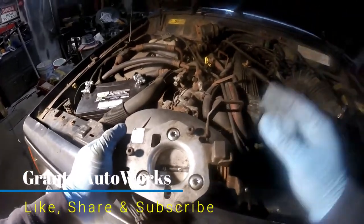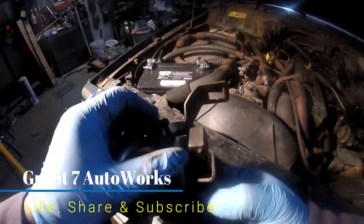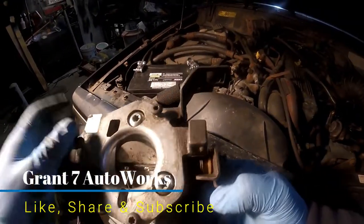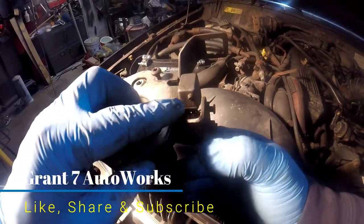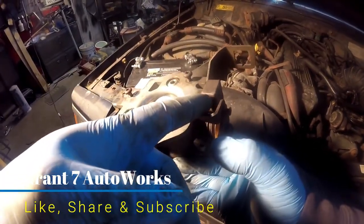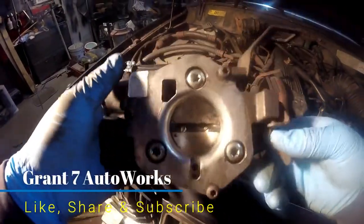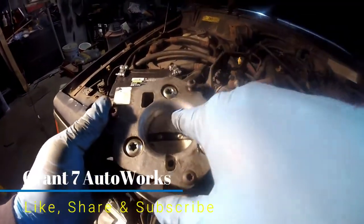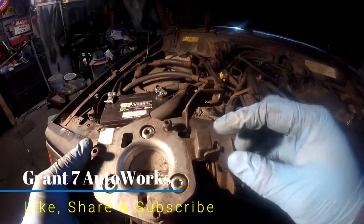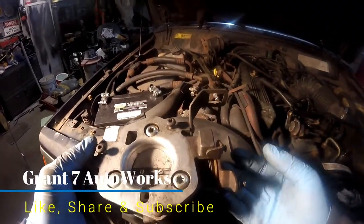So this is what I did to guarantee it works for me. I've not had problems since, so I figured I'll share it with you guys. You see this right here? This is your stop for your throttle. What you can do is use needle nose pliers or some grips and try to turn this in some. This controls how much air is getting by. Although the tolerance seems really small, just by bringing this in a little bit, it closes it a little bit more, restricting that air just a little bit more, and it actually brings the idle down.